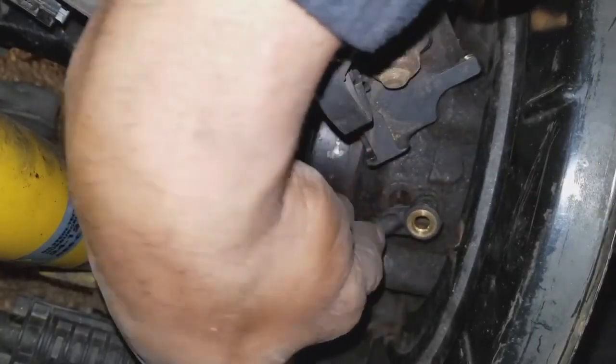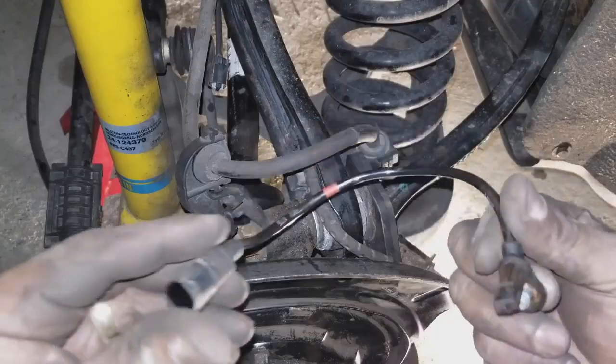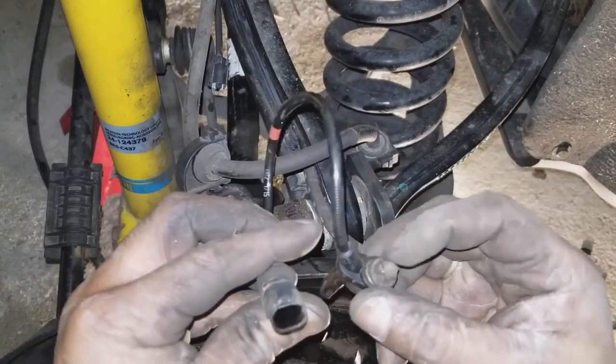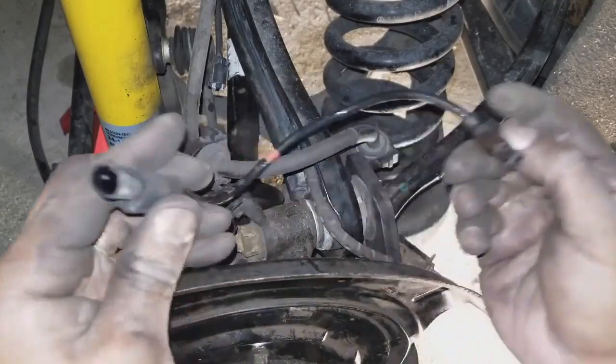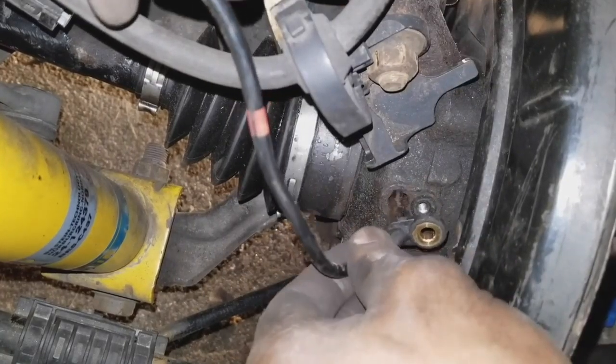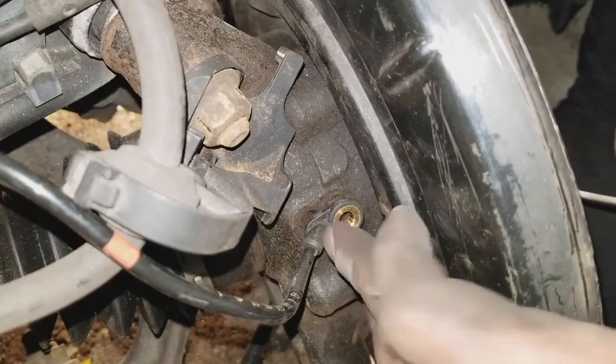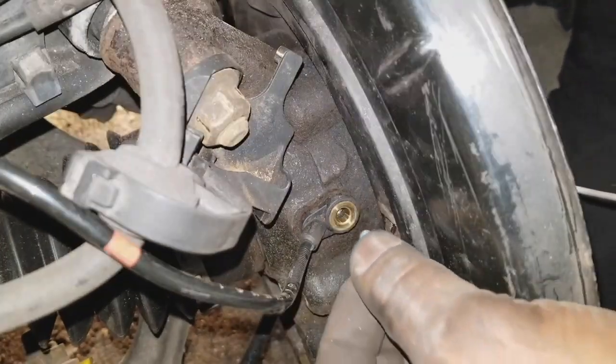Most of the times it's the harness to that wheel speed sensor. Look at that for evidence of a short, or maybe it might be loosely connected or corrosion has gotten in the connection points. If that's not the case, or if that is the case, replace that component. I have parts down in the description down below.